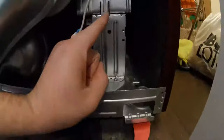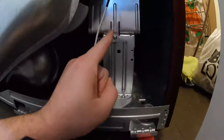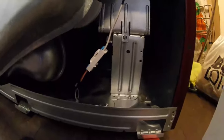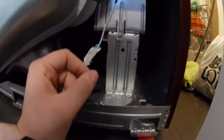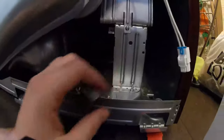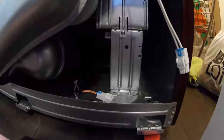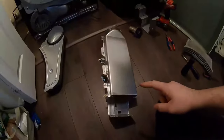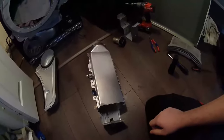Alright, so the front panel's off. Back in here, this silver box at the top is a contained unit — it's two pieces of sheet metal stamped together, and inside of that box is our heating element, as well as our temperature sensor and our thermostat. We'll take that screw out and unclip this wiring harness as well — just press down the tab and pull it apart. We'll have to pull that out of there and see what's going on. Hopefully we'll find a bad coil or something in there. This right here is our heating element; it's got several screws around the outside, so we can unscrew those and open it up.